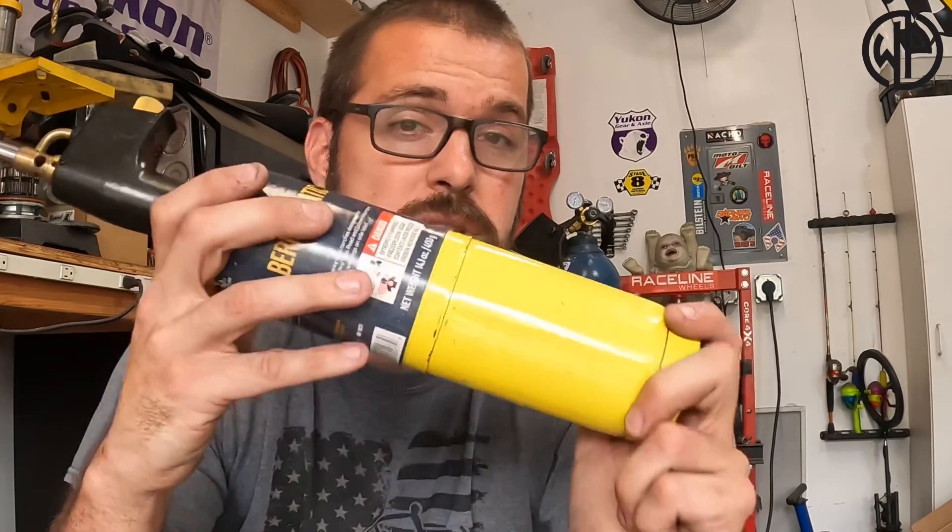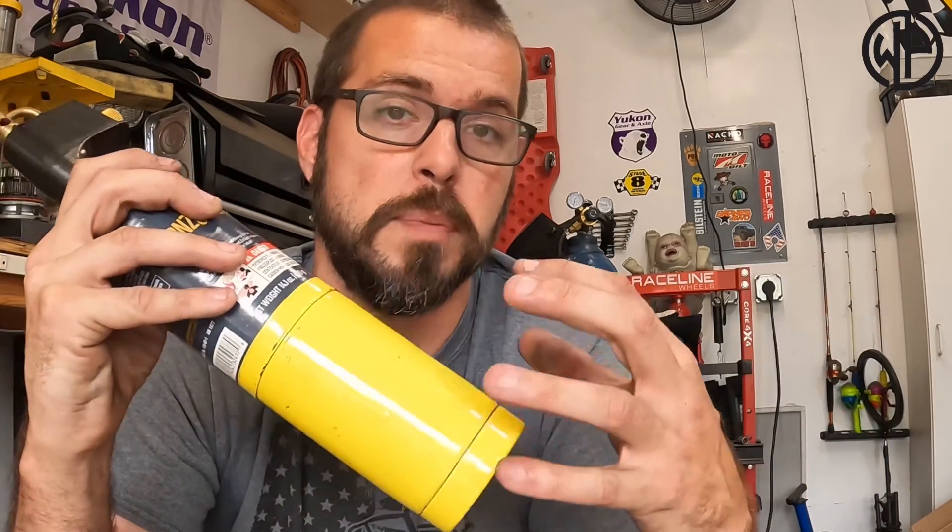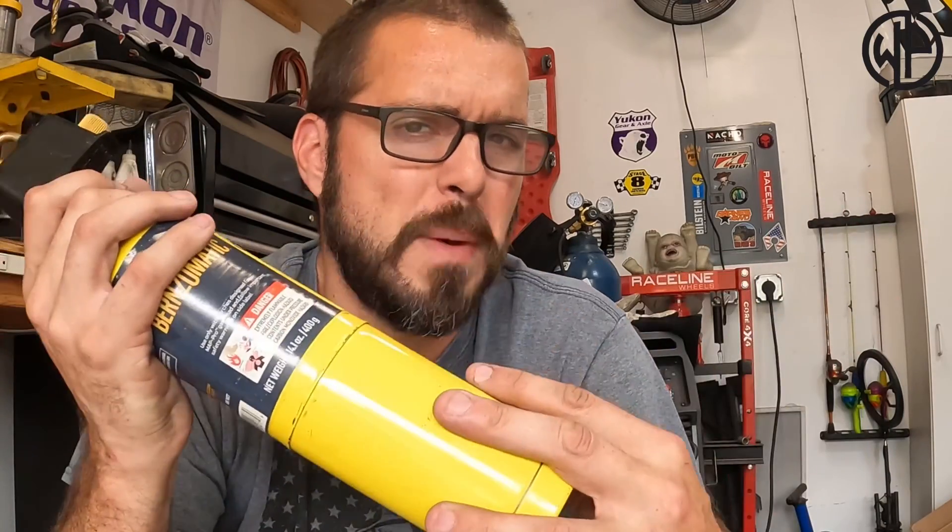There are a couple of things you're going to need: a good MIG welder — I have one from Eastwood that welds up to half-inch thick steel — an infrared thermometer, and a torch. I like to use a torch with a yellow bottle, which means it's MAP gas. MAP gas burns hotter than propane, which comes in a blue bottle, saves you time, and it's only a little more expensive — about ten bucks a bottle.